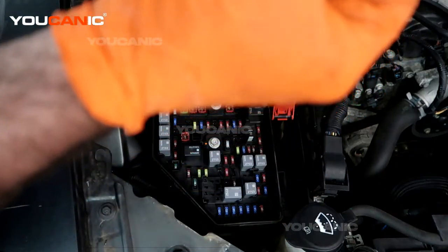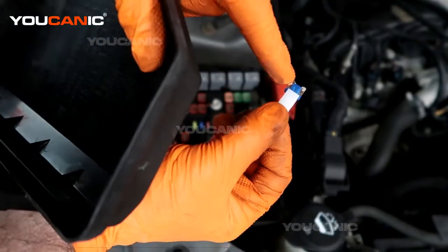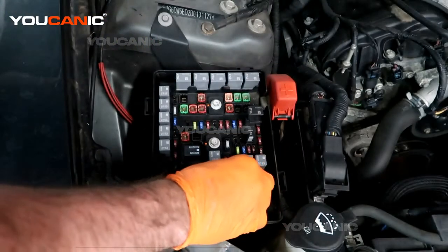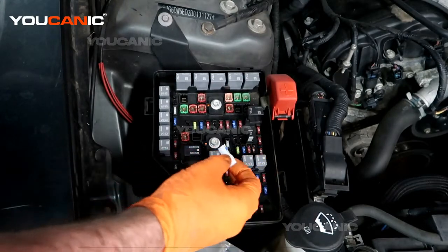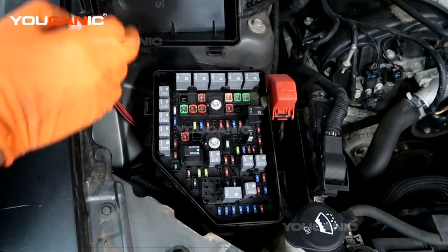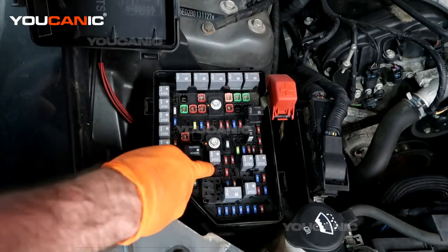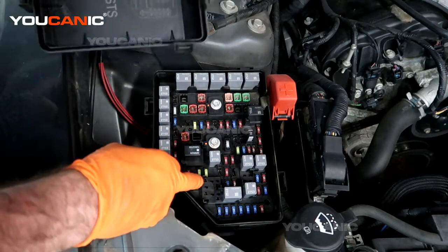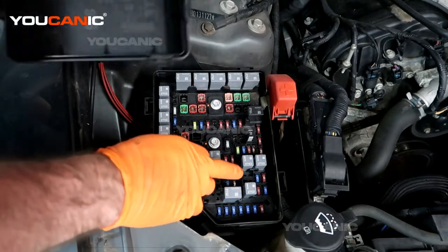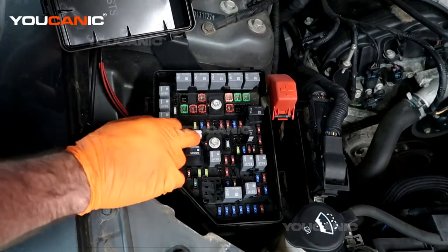Take a good look at it. Replace it if the little connector inside is bad. You can also check it with other means such as a test light. When you replace a fuse, make sure you match it with the same amperage — 10 amp in, 10 amp back; 15 amp in, 15 amp back. Don't put a larger one in, as you can cause other damage to your vehicle if you were ever to have a fault again.